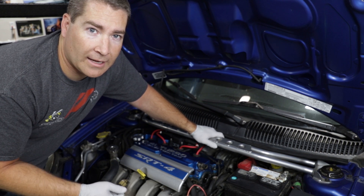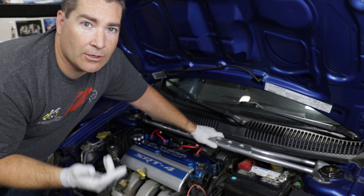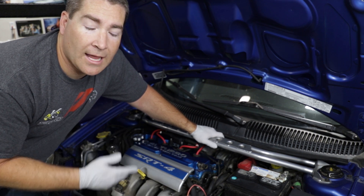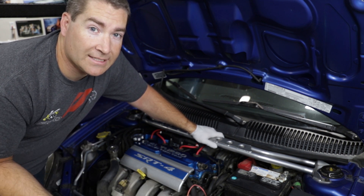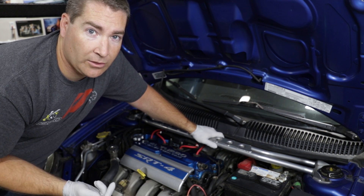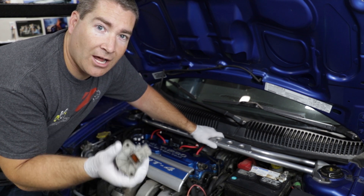The first thing I did was replace the coil pack, since I've heard that can cause an intermittent issue. Then I went ahead and plugged my Trinity Diablo Sport tuner in just to check if it would pop up any codes that my scan tool missed — and sure enough it did. It showed an intermittent cam position sensor fault code.